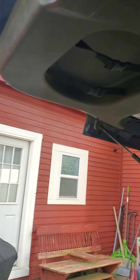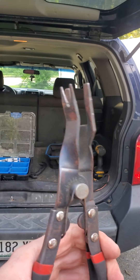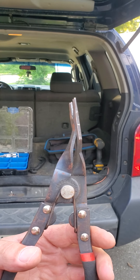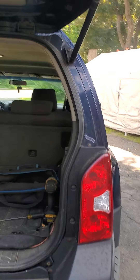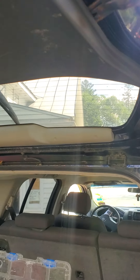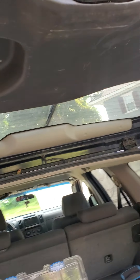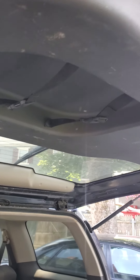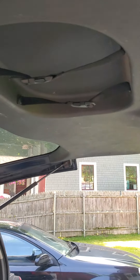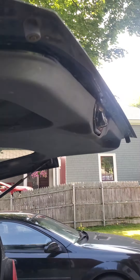I've got all my bolts out, now I've got to take the plastic off. This is a door panel tool — it's kind of like a pair of pliers, but it works great. You can do a lot of your own work like myself. You can get behind pieces like this and the door panel, just pop it off. A lot of times it will save your tabs that like to break otherwise. Just a little tip for you.